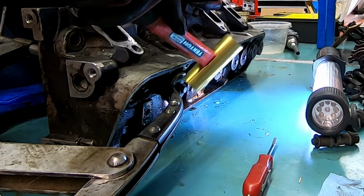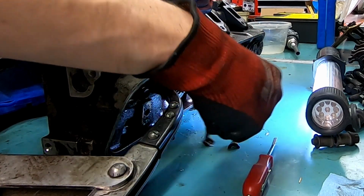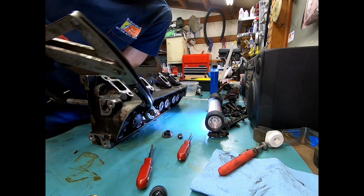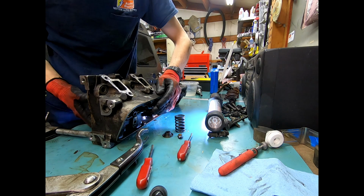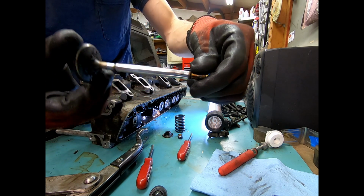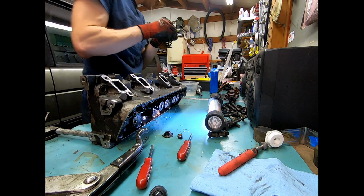Take our brass hammer. There's one. Ugh, yeah, these are just baked on. So these should free spin, and just in normal engine operation, all of these parts should be kind of free spinning and wiggling around with proper lubrication. But continuing the trend from the other side, I don't think this had the oil flow that we would be hoping for. So there you go. A little, some polished spots on the shaft. We'll check those dimensions, and then some more dark carbon buildup on this side.